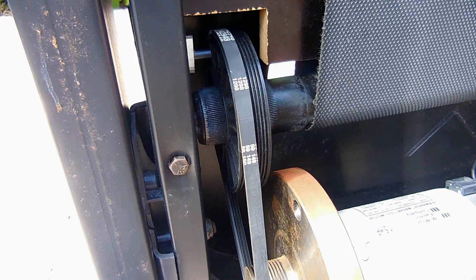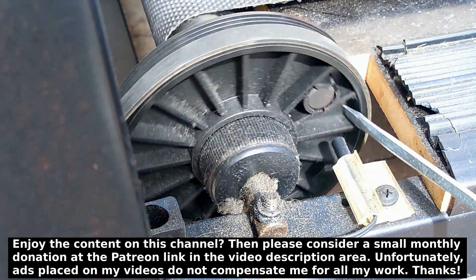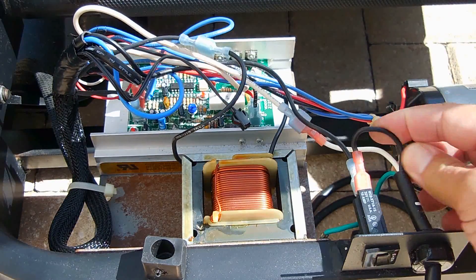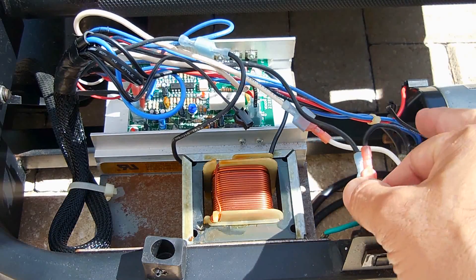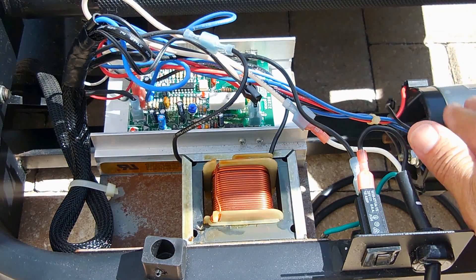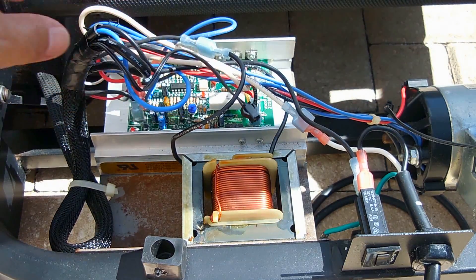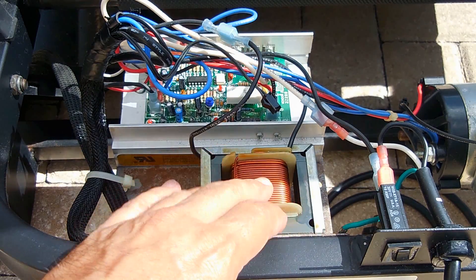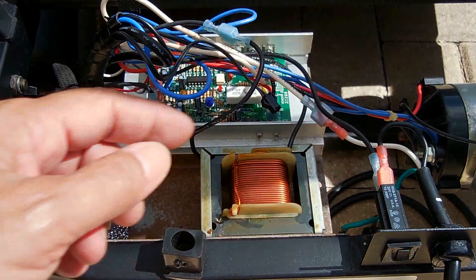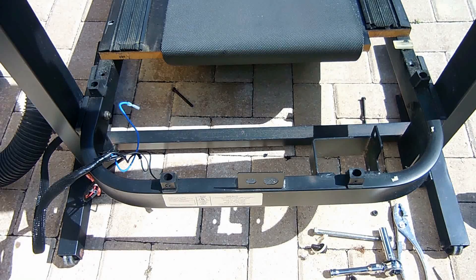Here is a better view of the magnetic sensor and you can see the magnet. This is the 120-volt supply coming in — it goes into this 15-amp circuit breaker, which will be salvaged. This board right over here is the speed controller board for the permanent magnet motor. DC pulses drive this motor — it's pulse width modulation. This part right here is used to limit the inrush current into the permanent magnet motor; it's connected in series with one of the wires powering the motor.